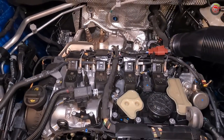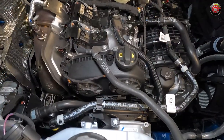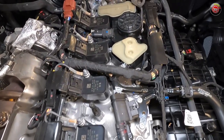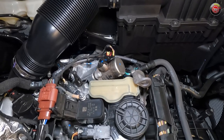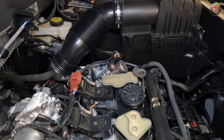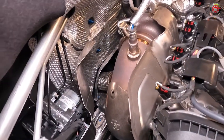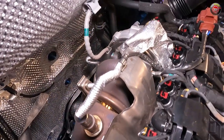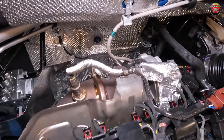That's an increase of 34 horsepower and 15 pound-feet of torque over the previous generation 2.0-liter engine. The engine features a cast-iron block and aluminum head, a very rare combination these days. Chain-driven dual-overhead cams both feature variable timing, and variable valve lift is on the exhaust side. A balance shaft helps produce refinement and smoothness. Direct fuel injection pressure is increased on the new engine to 350 bar or 5,076 psi. It has a relatively high compression ratio for a turbocharged engine at 9.6 to 1, and maximum boost pressure from a single-scroll turbocharger is 20.1 psi. Boost pressure is controlled via an electronically controlled wastegate and the variable lift exhaust valves.